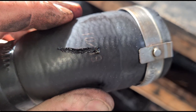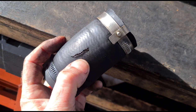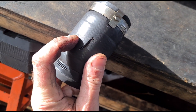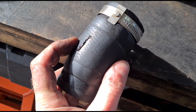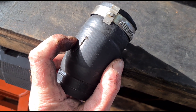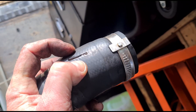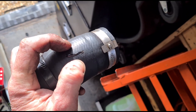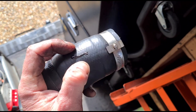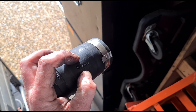I've cleaned it up and now I've put some glue in there. I'm just going to glue that up temporarily because the part is not available right now — we're going to have to get that ordered up. So just a temporary repair: we'll put some glue on that and tape it just to hold it from expanding. Get the replacement part ordered up and we can get that fitted. We're not going to be able to clean the DPF with a boost leak, so just get this leak sealed up and then we can clean the DPF. Once the new pipe comes in we'll get that fitted.